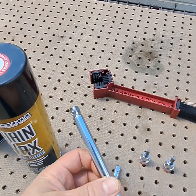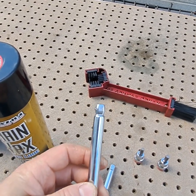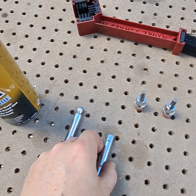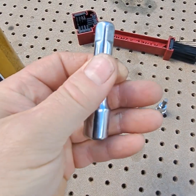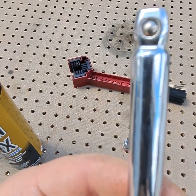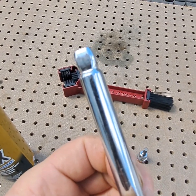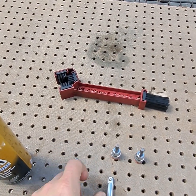You want a six-inch or five-inch wobbler extension. Now a wobbler is different from a standard — this is a standard, it's straight and flat, there's no curvature. The wobbler — you see how it's curved? That will allow you to pivot the socket just slightly off-center to where you can get a hard-to-reach spot, no problem.